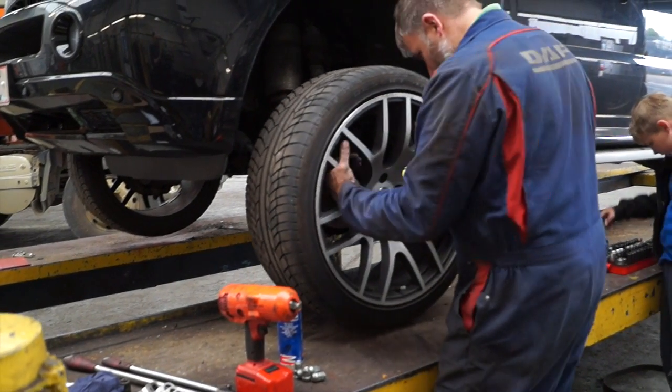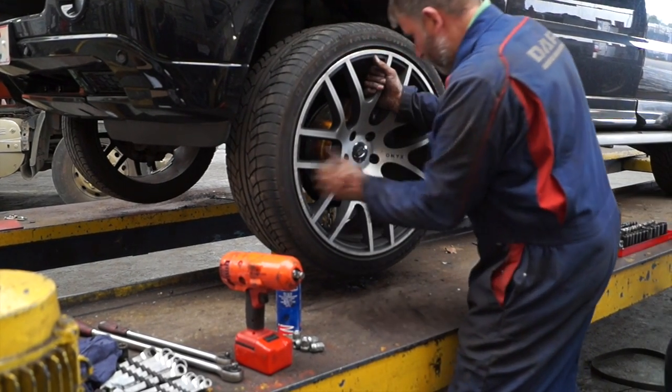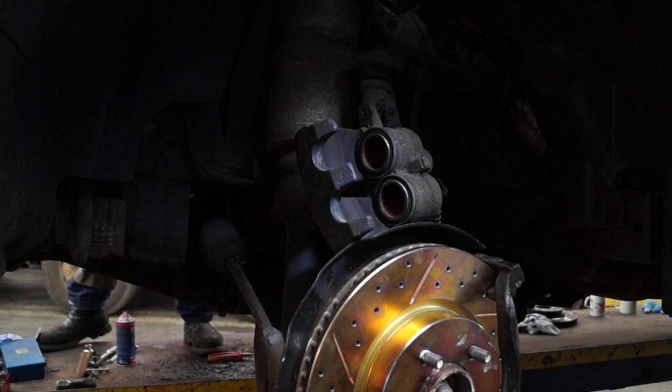Remember that the brakes haven't been set yet, so I would advise that you pump the brake pedal to make sure you get the slack out of it before the engine's running or before you drive off. This is vitally important that you push the pistons out till they make contact and it's clamped the disc. You'll notice this on the foot brake pedal because it will go solid. This is with the engine not running.